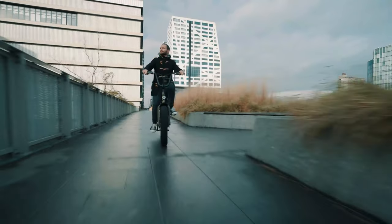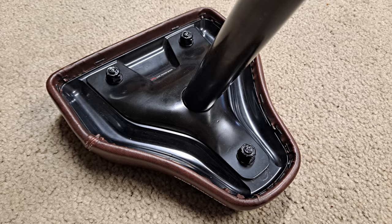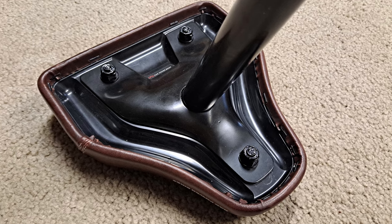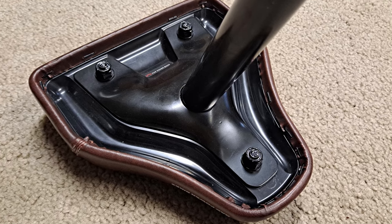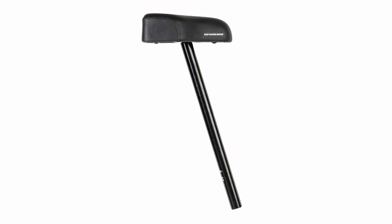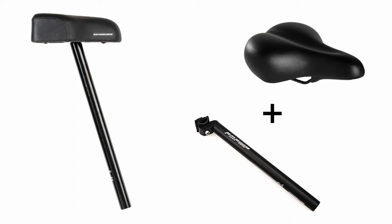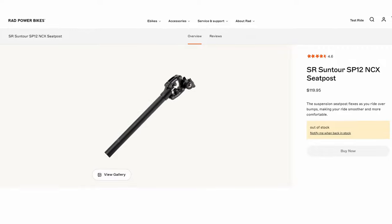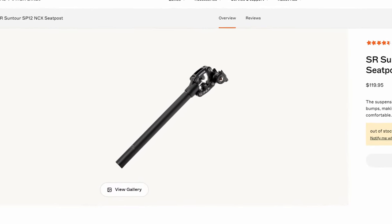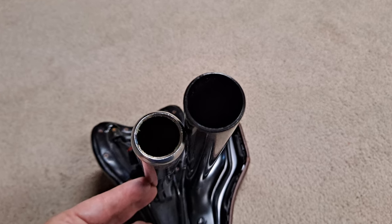The main seat of every version of the Runner — the 1, 2, and Plus — has a custom seat post with a metal plate that bolts onto the Rad Runner seat. As Rad puts it, it's an integrated steel seat post at a fixed angle. So keep in mind, if you want to switch out the stock seat, you'll be required to purchase a new seat post on top of the new, more comfortable seat. Rad sells the Suntour suspension seat post, which is what they'll usually recommend as a replacement, but the Runner takes any 27.2 millimeter seat post, so any third-party option in that size will work.